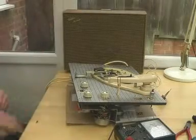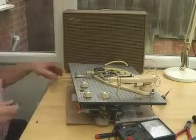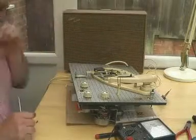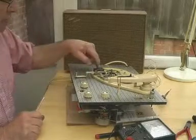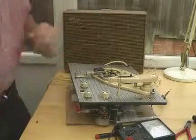I was putting the thing on its side to check the supply to the motor when there was a sudden click and the motor came on. So it seemed intermittent, and I believe it's this switch, which is the on-off switch for the motor. I'm going to have a look in there — maybe a dirty connection.